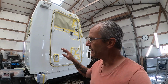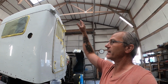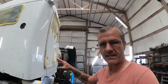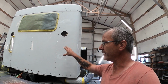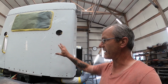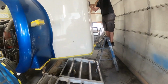Now the next step is I'm going to have Ash and Brent, the two working on this one with me this time, sanding and scratching the roof, sanding and scratching the hood, sanding and scratching the rivets around the doors, some of these things that aren't getting in the way of what I'm doing, which is going to be marking out and sanding and beginning to fill in the amount of dents that the back of this truck has. And again, for one of these guys' trucks, this is the worst I've seen by far. This is pretty damn dented up.